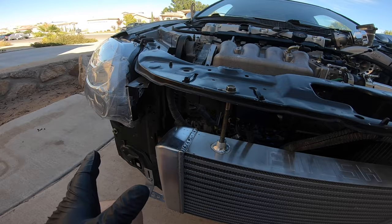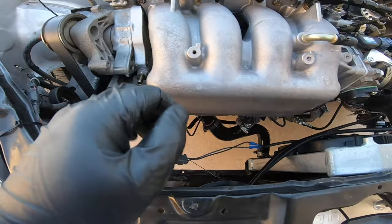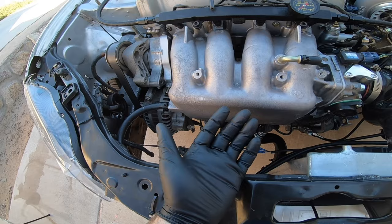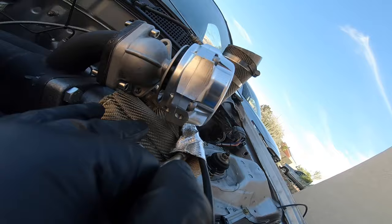Alright, this isn't pretty but hear me out — things can be changed. I'm just using what I have on hand, I'm not going to the store. So I got the block plate here, zip tied — not pretty but it'll work. I got the hose coming on this side of the manifold. I'm not using the PCV port. I'm just running hoses over to the blow-off valve and fuel pressure regulator. The next best thing would be to drill underneath the manifold and put some ports, or secure the block underneath, but I didn't do that — it's just temporary to get everything going.